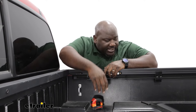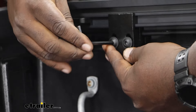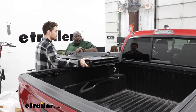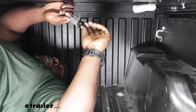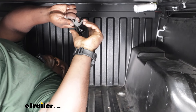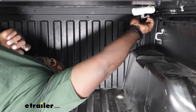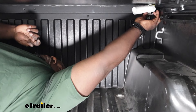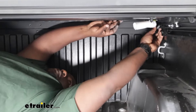I have Ethan here giving me a hand to team-lift our cover into the bed of our truck so we can position the tie-down points. I'm going to remove the wing nut from my clamp assembly and unthread the hand nut down a little bit to make it easier. Now we're inserting it into the keyhole slot underneath our cover and getting the aluminum bracket into the fitting. It may require a little bit of adjusting with the cover.